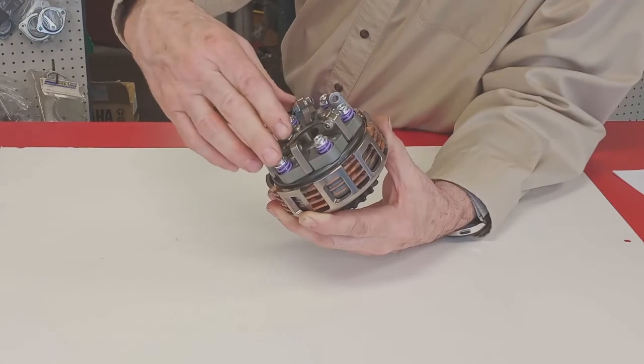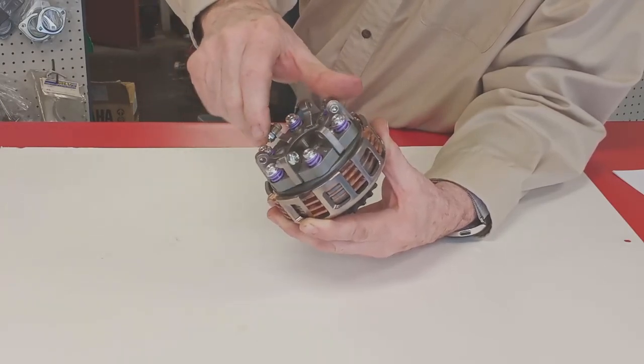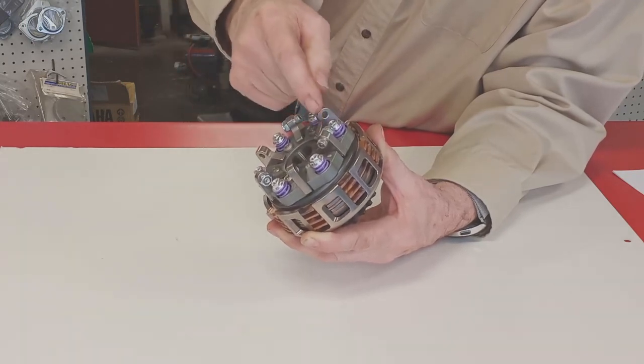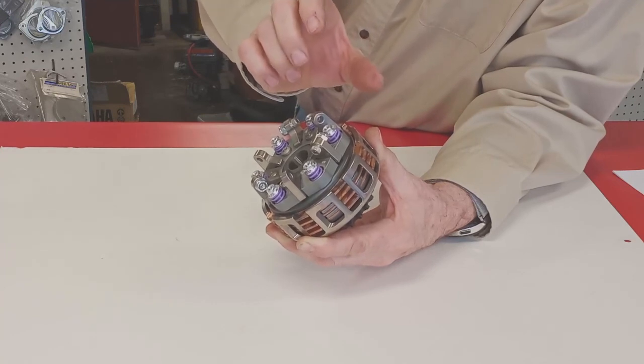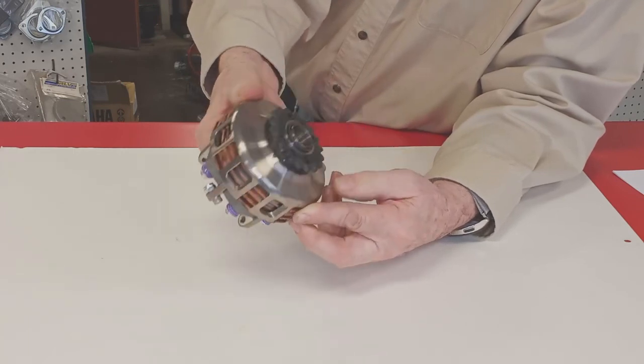As the inside of the clutch spins, centrifugal force from the weight levers increases as the RPM increases, and that force works to overcome the springs that hold the discs apart. As the discs squeeze together, they transfer torque to the drum, and from there to the chain.